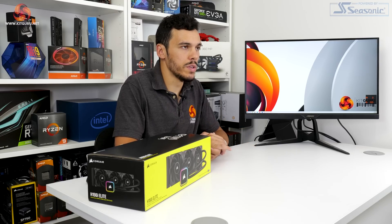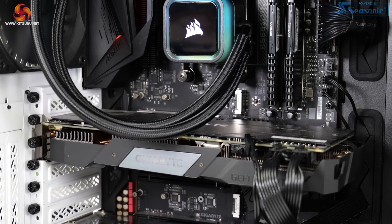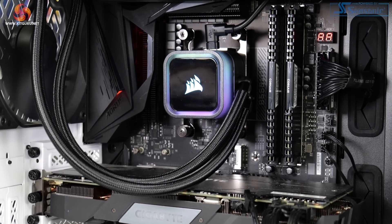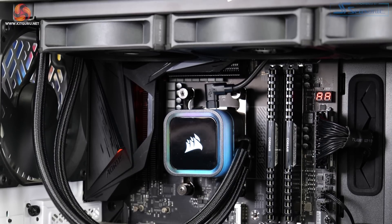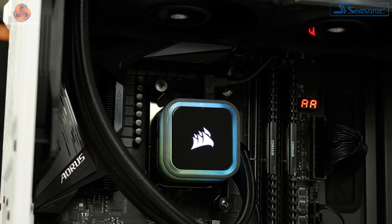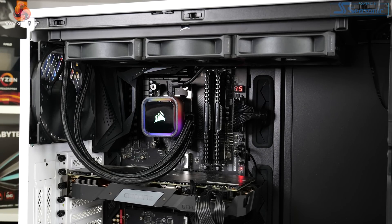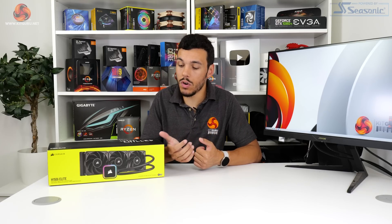One of the areas of refinement for Corsair's design has been on the pump. The new design features 16 individually addressable RGB LEDs which diffuse into an all-around housing. The pump itself is capable of varying its speed via iQ and runs at 2900 RPM under its highest extreme speed profile in our testing. The understated look of the pump top with a simple Corsair logo cover and RGB surround is very appealing. The AF120 Elite PWM fans used on Corsair's cooler do not feature RGB lighting — it's the pump that covers LED duties.